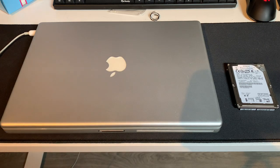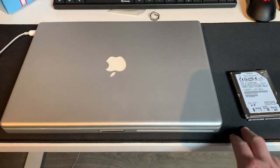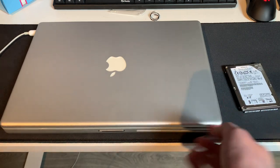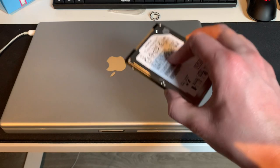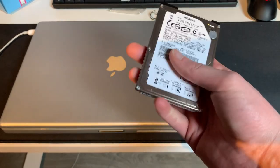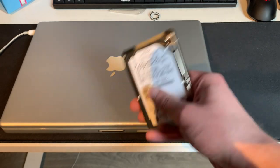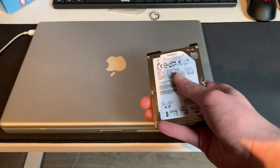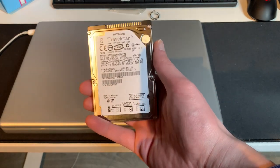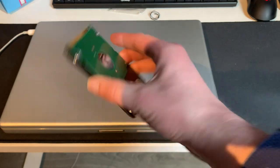YouTube. In today's video, we're going to replace this old aging hard drive with an SSD. Yes, this is not in chronological order. I have already replaced the existing hard drive from this PowerBook with an SSD. I bought a 2.5-inch IDE to, or actually it's an M.2 SATA to 44-pin IDE converter. I'll link it in the description which one I bought, so you can get one for yourself.